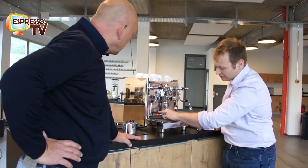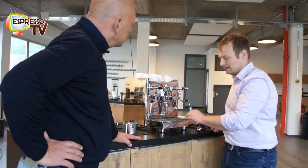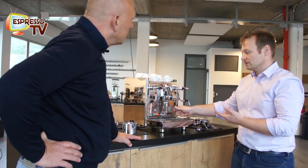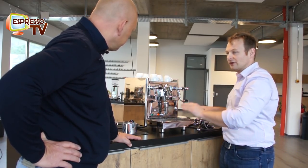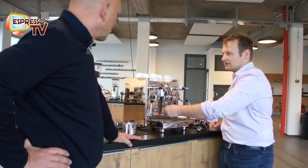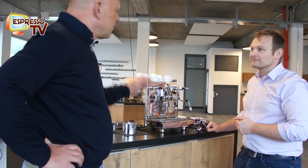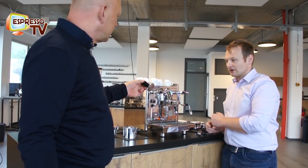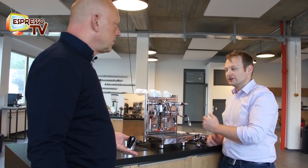CLN is cleaning mode. You can set a value from zero to 200, which gives you a counter on the display. So you set it to, say, 20 — after 20 shots where the coffee extraction took longer than 15 seconds, it counts for one shot. The flush will not count. So after these 20 coffees, you start cleaning. What I see here is something new — a new tamper. That's the tamper which is our standard tamper, included in all machines starting from the Mechanica Slim, from the heat exchanger to the electronic.